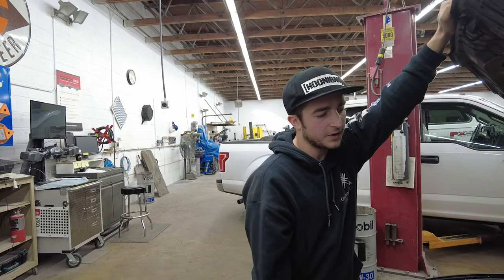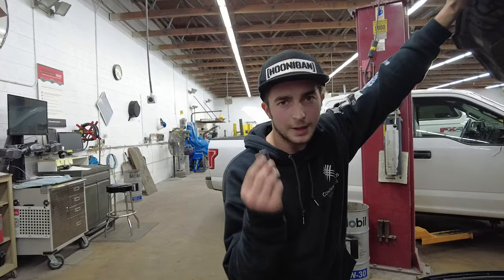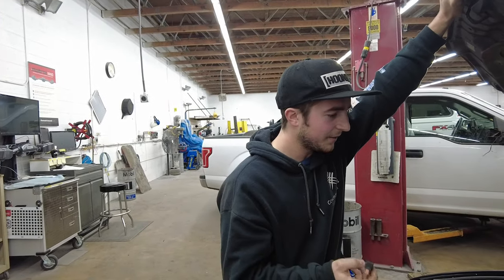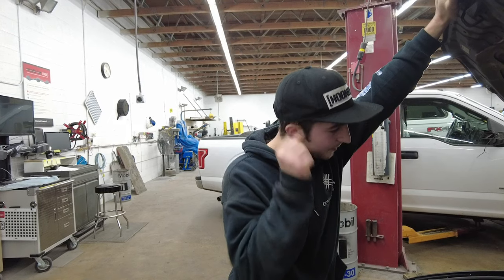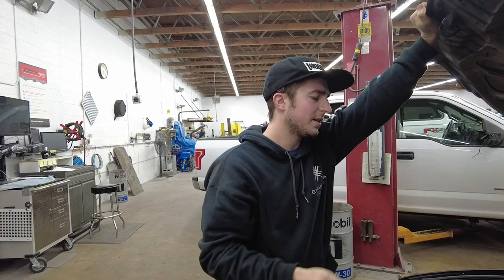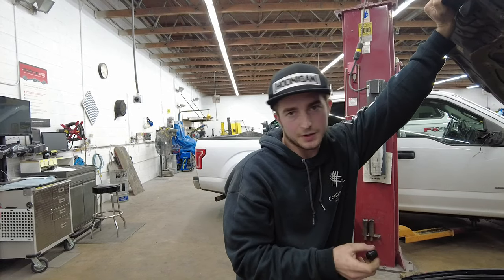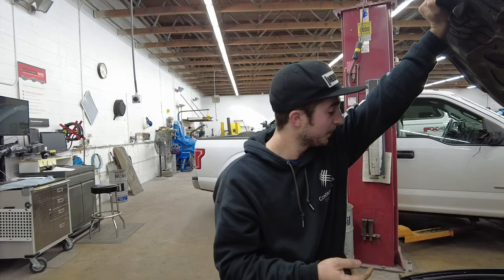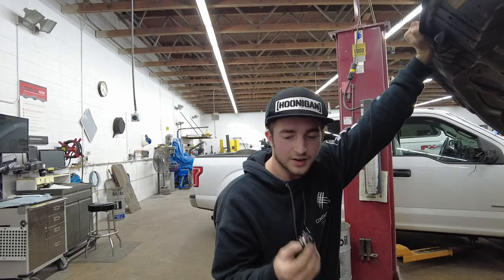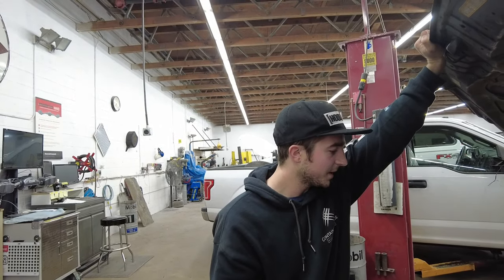I mean, you would figure it out if it was happening with your car, but her EFI relay won't stop clicking with the key off. And these cars only prime, they don't like prime the fuel pump with the key on. They might, but I don't think they do. I haven't really looked into it. But it's a returnless system. And so when you key it, it's fine. But with the key out, it just opens and closes the EFI relay because there's,